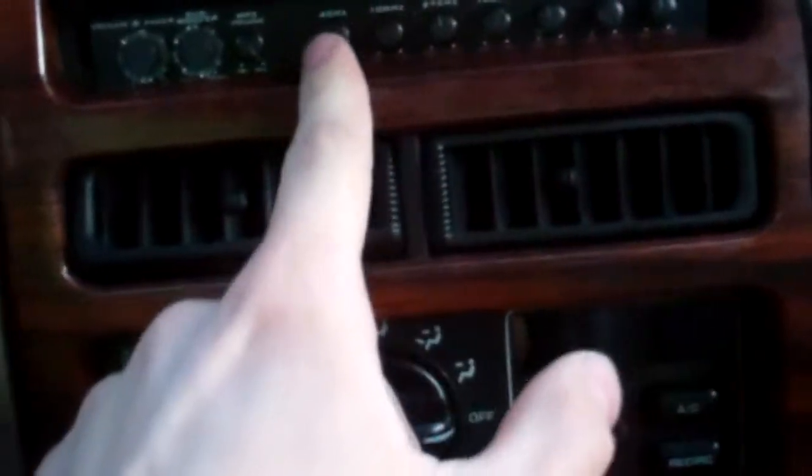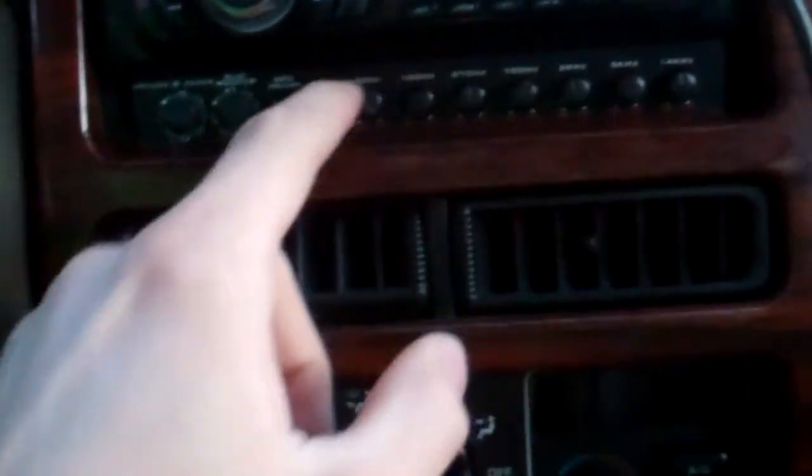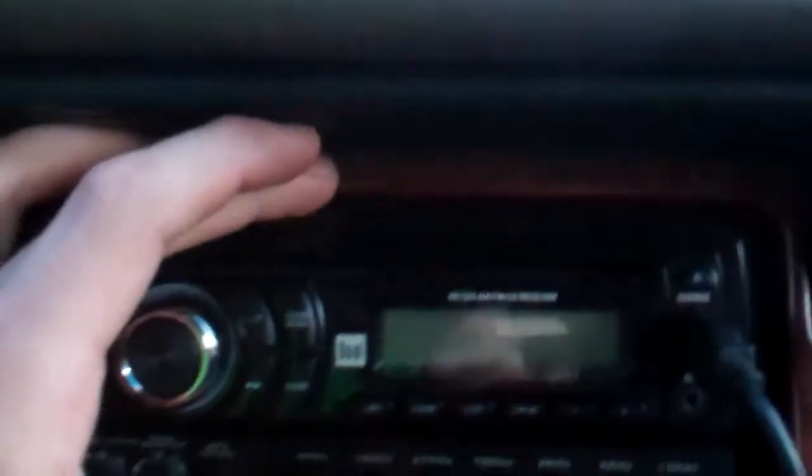If you're going to get an EQ, plan on working on it for a while, because everything has to be fine-tuned to sound good. Especially with the 7-volt line driver — it makes everything distort and you've got to set your levels nice. It's hard. Alright, BlackMamba, hope that helped. Just cut down your dash kit — it's real easy. It all just jam-packs in really tight because there's not much room. Look at how small that is.